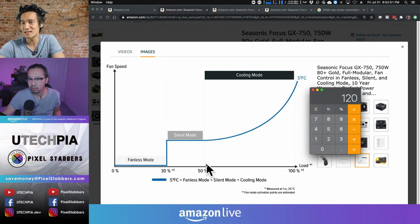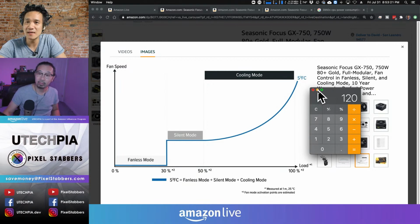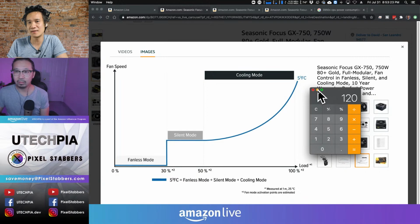But with your graphics card, the 2080 Ti itself draws almost 280 watts by itself. And then you have your CPU too. So okay, no wonder. So, oh no. Yeah. So if my current computer right now, I want to upgrade my graphics card, I'll also have to upgrade my power supply too. Because I believe you probably have a 400, 500 watt power supply, and on your computer we're not going to put a super crazy graphics card. We'll be okay. Because, okay. Yeah, because you also have to keep in mind that when you're gaming, guess what your CPU is not doing?